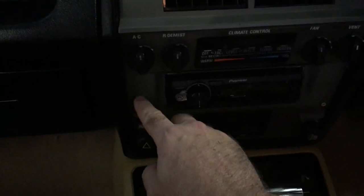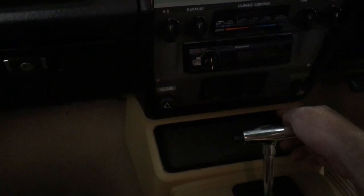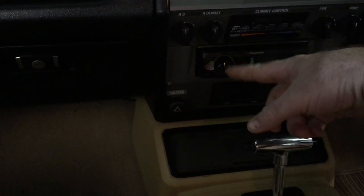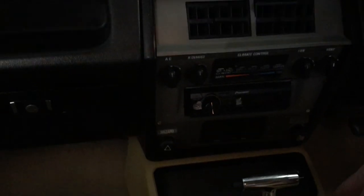You buy these aftermarket things that fit around the stereo — you get these off eBay. You can also upgrade to your clock or whatever, but this is an S-Pack so I've already got it. So pull the old tape deck out and you'll see there's four wires — it's pretty straightforward. You just need to work out with a multimeter which wires are which. The speakers are here and they're easy to get out.